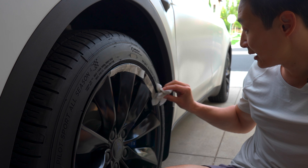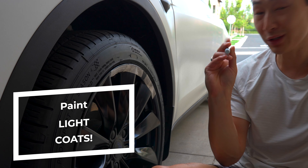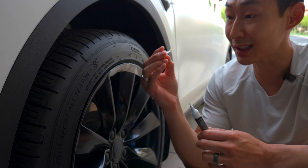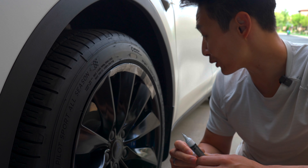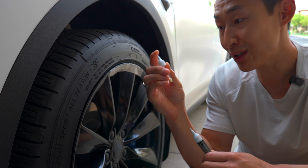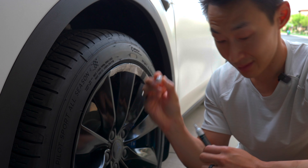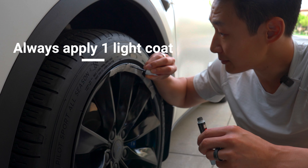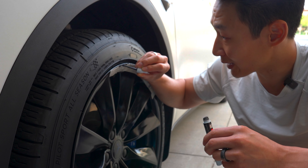Let me go ahead and wipe it one more time with the alcohol — there we go. Wiped it with the alcohol to get rid of any excess paint. Two steps done, now we're on our last step. We've got our paint pen here — it has a little tip. I'm just going to go with the line of the damage and go down. They said you can use this pointy tip to cover areas where it's really small and thin. So one light coat always first — I'm just swiping down in one motion with one coat.